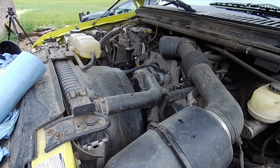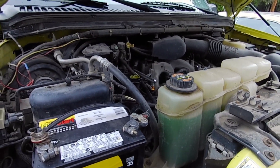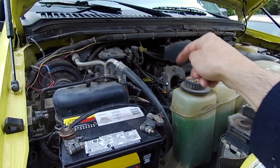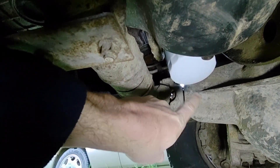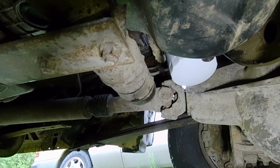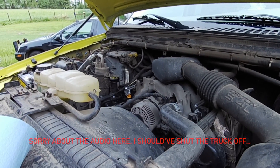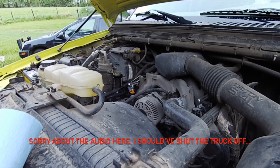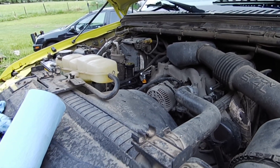Listen to that — it legitimately does sound better. You can actually hear there's a bit of an exhaust leak on this engine on this side, and a lot of the bad noise is actually from that. We're just going to climb back underneath with it running and check for any leaks. You just want to make sure there's no oil dripping off the filter — that would indicate the gasket's leaking. Everything's looking good. The truck legitimately sounds much better with the new oil in it. Just left it run a few minutes to let everything circulate and yeah, it's running really nice.